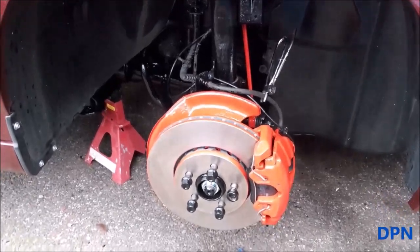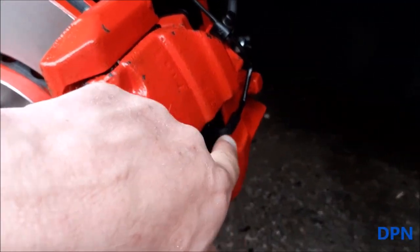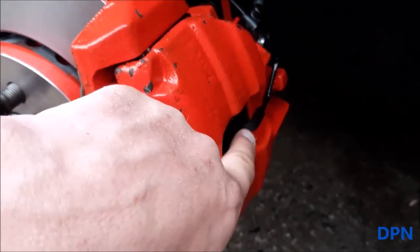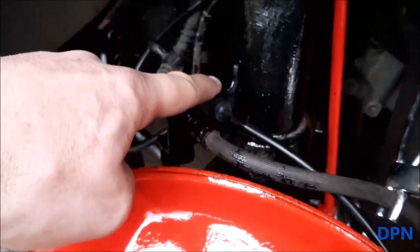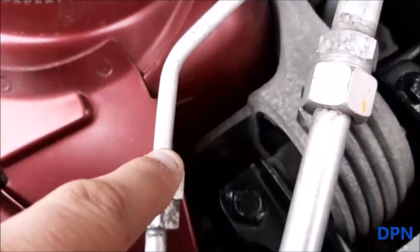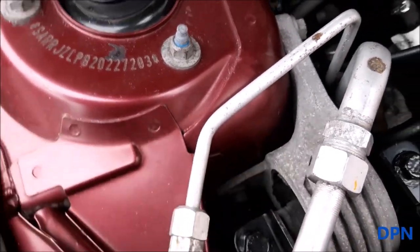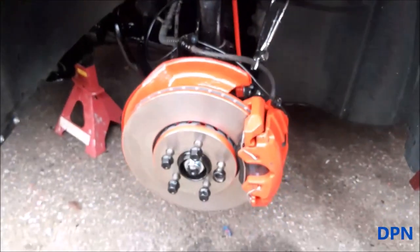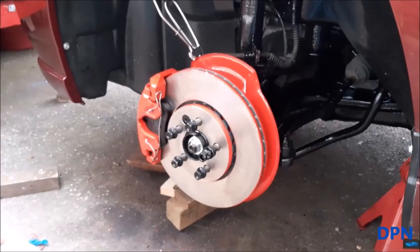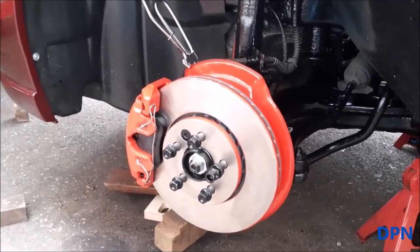In the daylight, the driver's side is now finished as well. The only difference with the driver's side, similar to the backs, is the little wear-down sensor — we changed that with a new piece of wire. It goes into the clip, then up under the wheel arch through two little grommets, with the plug down by the engine mount. That's the only difference between the driver's side and the passenger side. And on the passenger side, the job is more or less done.